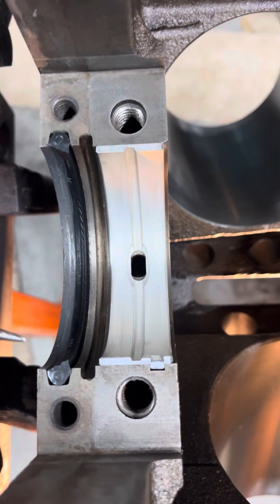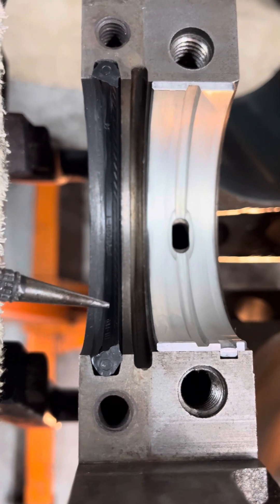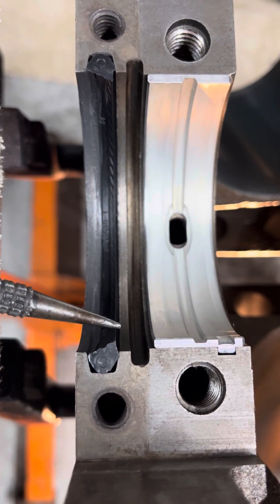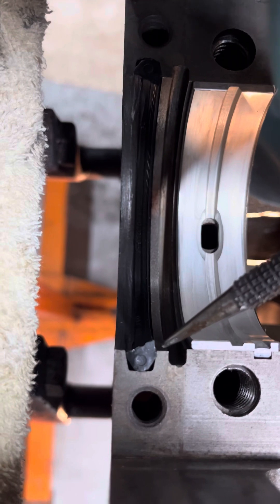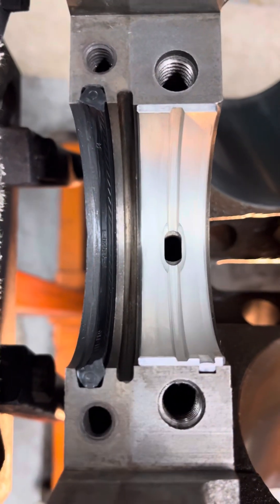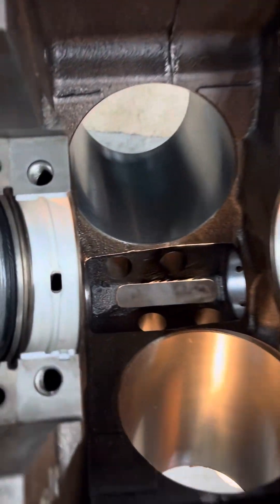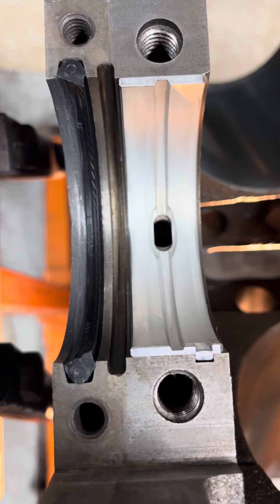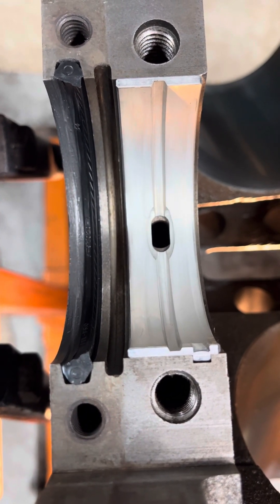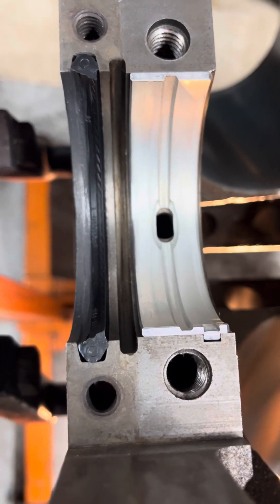The way this works — I'll try to get a good straight-on shot so you can see the cross-section. There's this lip; I'll call this the big end of the lip, and underneath it is a little bit of a groove right down in here. If you can imagine, the crankcase — the inside of the engine — is going to be filled with pressure and it's going to want to push that up. The weight of the crank, everything torqued down, the crankshaft itself is going to be pushing on that so it has a tight seal.